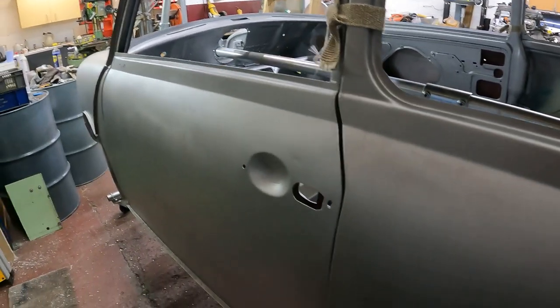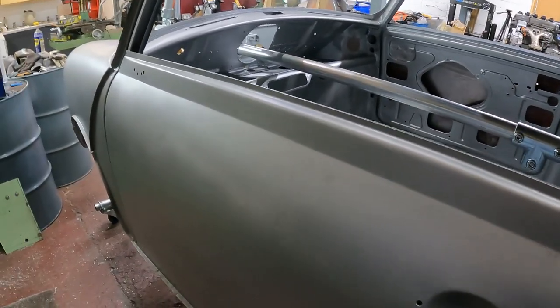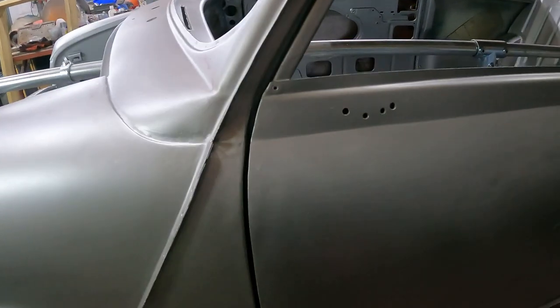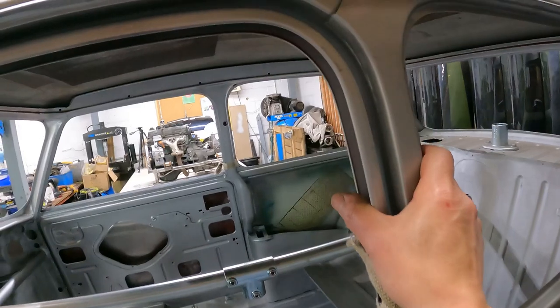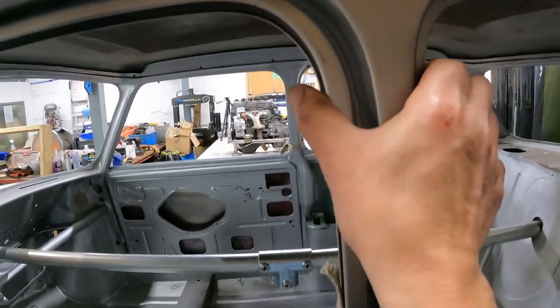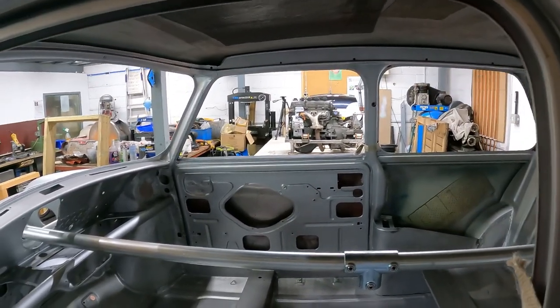So yeah, it's quite inspiring when you see it all one colour. It'll be even more inspiring when it's got the epoxy on there and I can start fine tuning it. I've got the door gaps pretty good. I've been messing around with the packers behind the hinges down there. I also have a trick of wedging it shut here and clamping that there to try and drag the top part of the window frame where I want it to try and even out these gaps.